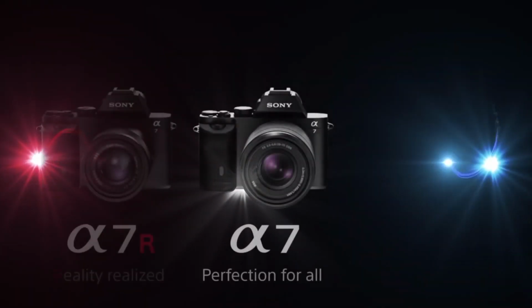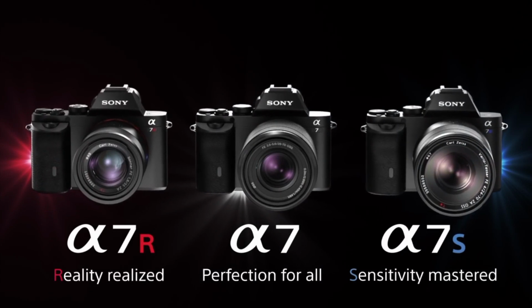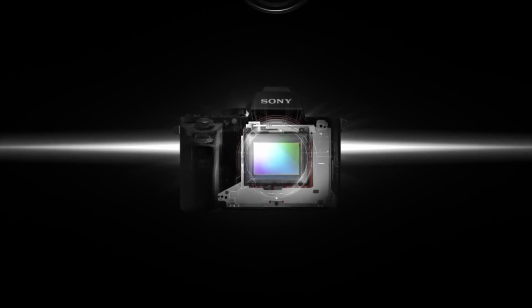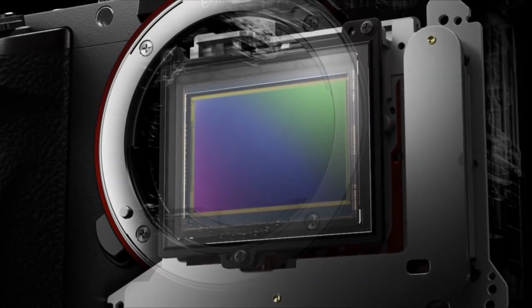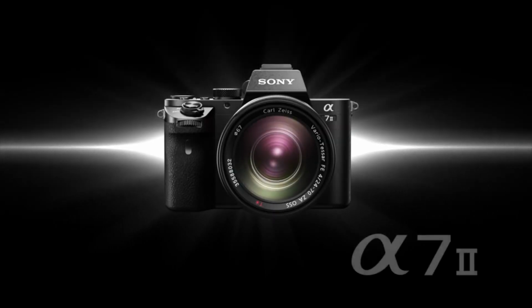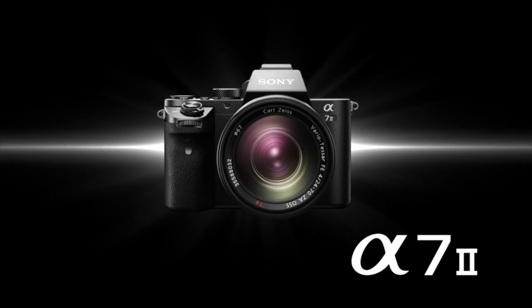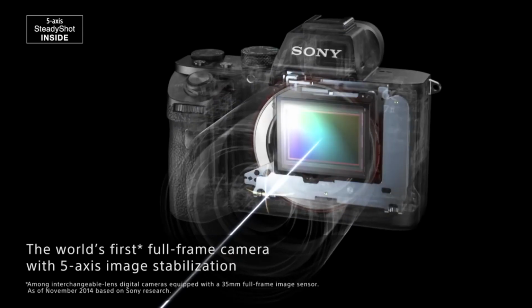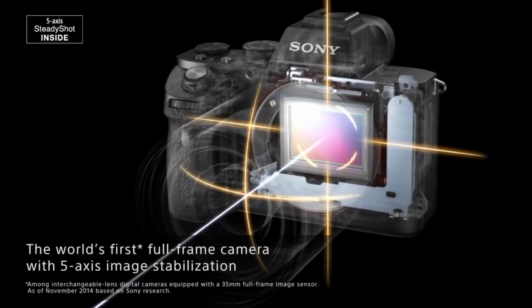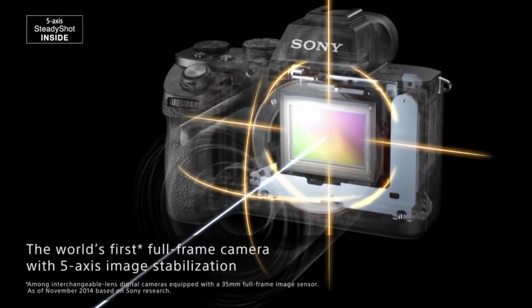Physically, the camera uses a magnesium alloy construction which affords it moderate weather sealing, and it makes the camera quite durable and robust. However, the trade-off here is an increase in weight. In this case, the camera now weighs 555 grams body alone, an 18% increase over the predecessor. Otherwise, the camera maintains the same modern aesthetic, and all of the buttons remain in the same positioning as the original model. But Sony did redesign the grip, and they've also repositioned the shutter button so it lands naturally exactly where you would expect it.